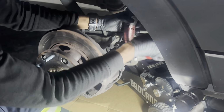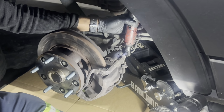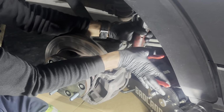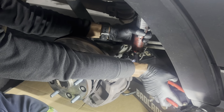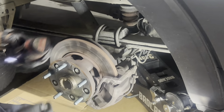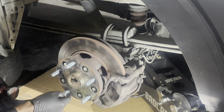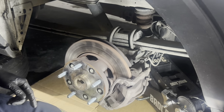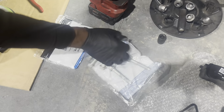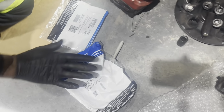And the new brake pads, if you order from the dealership, come with new bolts, so we'll discard those. Also, guys, these hub bolts, when you go to remove those, are one-time use only, so you want to get new ones. We got five of them here, brand new from the dealer. Your part number, if you ain't already got it, is on the previous slide.